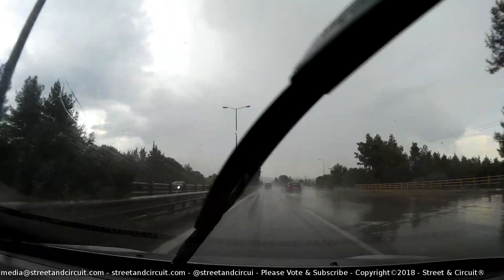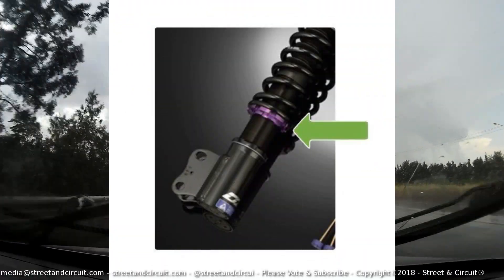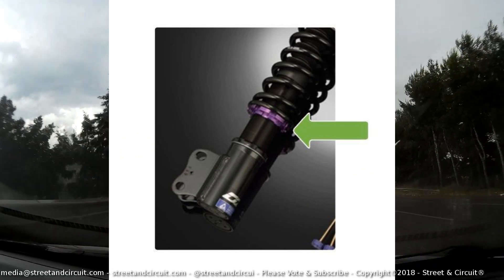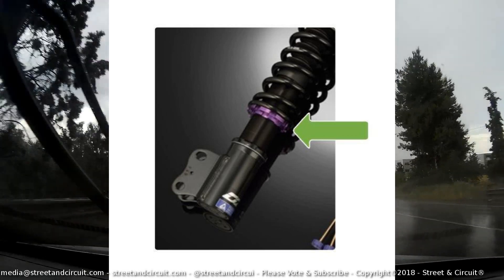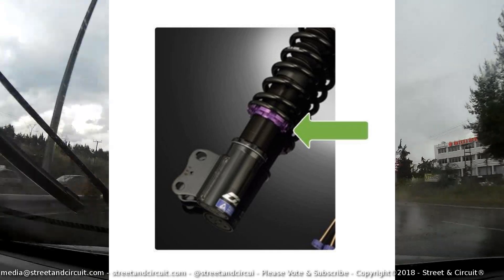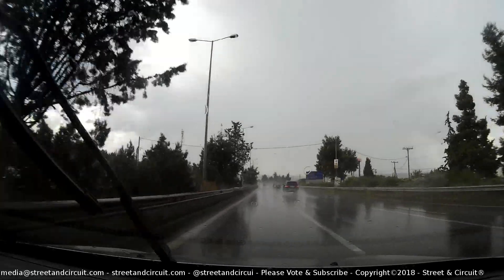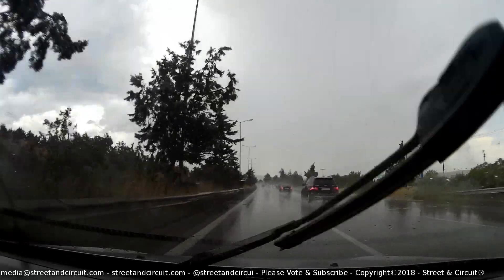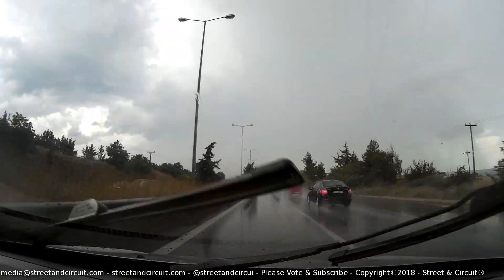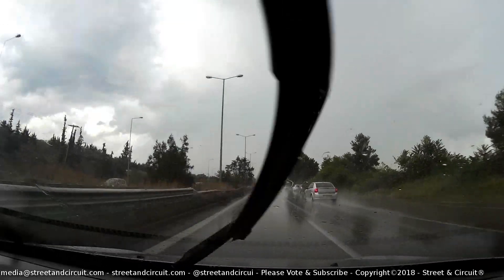You just want the spring seat to be pushing the spring against the top mount so you don't have any looseness with the spring on the damper, but there's no danger of the spring becoming dislocated from the spring seats at the bottom or at the top. That's solely the reason for that. Once you just put it in there, not even compress the spring at all — there might be no need. As long as the spring's not loose, that's fine.